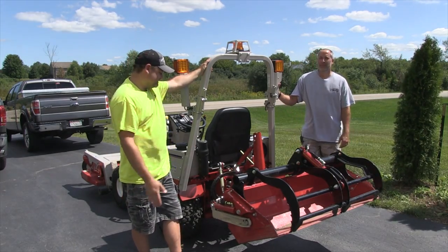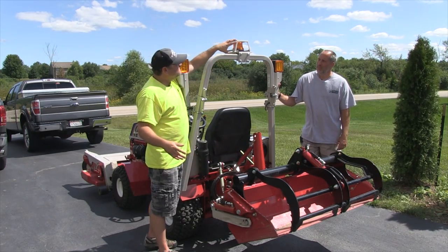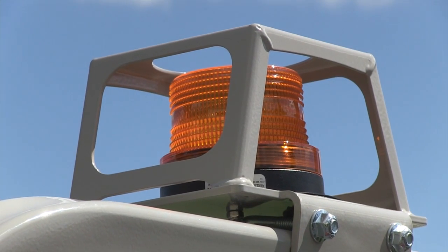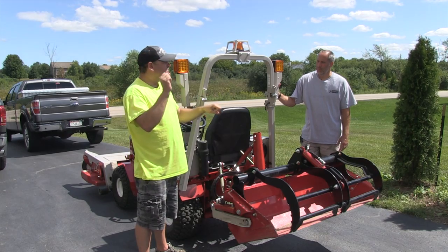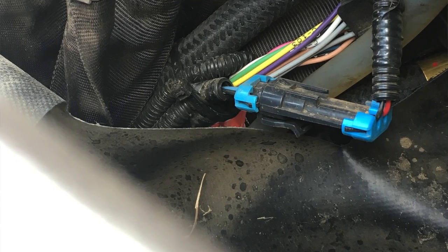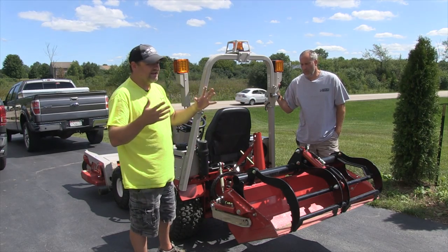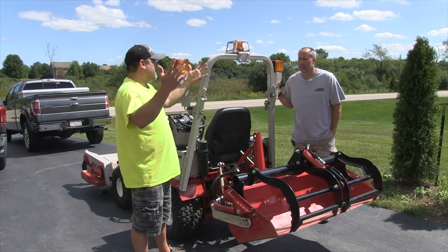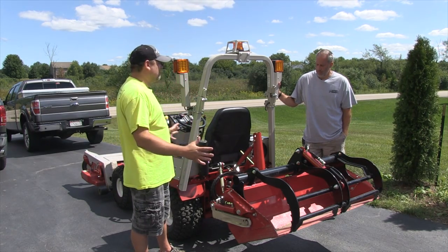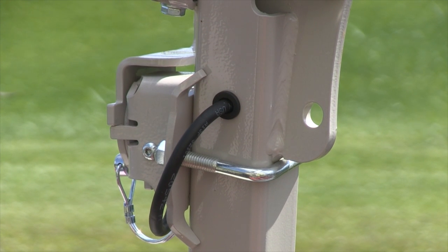With the beacon light up here — sure I could have got a cheap beacon or even a top-of-the-line Whelen beacon — but it doesn't come in this nice protective cage which is designed for the vehicle. I'm not drilling any holes in here. Everything runs right through, and the instructions have you go right underneath the dash, plug and play. It's an automotive connector — not just butt splices — a real automotive connector with a rubber O-ring around it. When you click it in, it's held in, no moisture is going to get in, and that's going to save the life of the vehicle and cause a lot less electrical problems. With this vehicle I just want to keep everything top-notch and reliable.